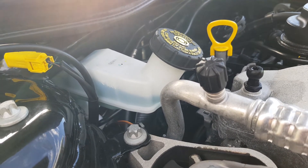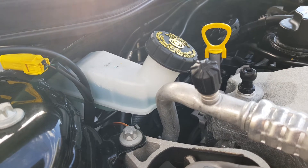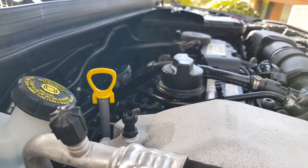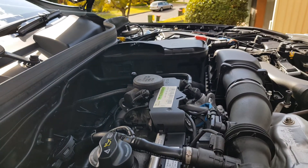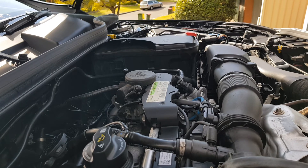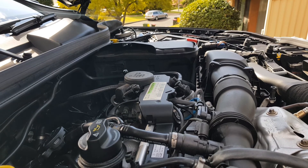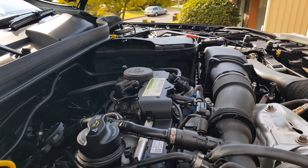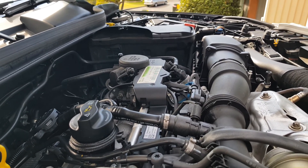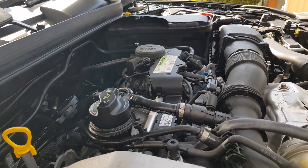I hope you enjoyed this short video giving you an idea of the importance of maintenance and some of the tests that can be done. Battery, coolant, brake fluid, transmission fluid — for transmission fluid, I generally start looking at around 60,000 kilometers to see how contaminated it is. If it's significantly contaminated, I'll change it three services in a row, because you can't get all the fluid out — a lot gets left behind in the transmission and torque converter.